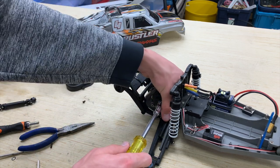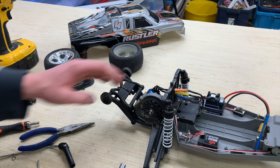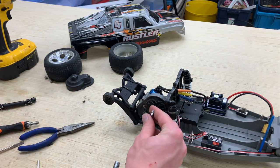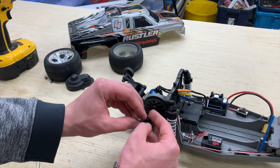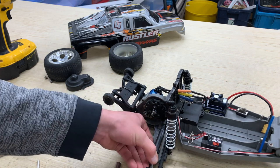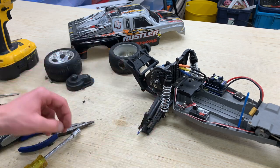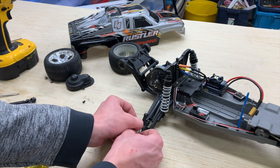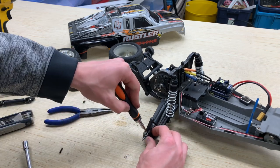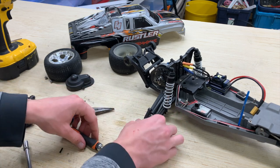Tighten it down holding your new half shaft on there. Once it's tightened down all the way, do about a half turn open and you should be good to go. Now we're going to put in our lower half shaft. Take a teflon washer and make sure to put it on the axle before it goes into the bearing, then slide it through the hub carrier. Take another teflon washer, then your axle bar, then hex hub, and torque that down so it doesn't come off.